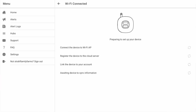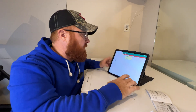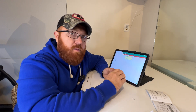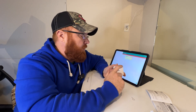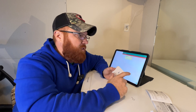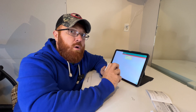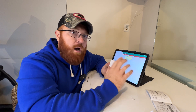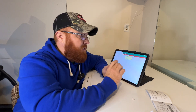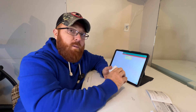We're just waiting for it to say congrats — hopefully it'll pop up here in a minute. One hour later. After about an hour of frustration trying to figure out how to make these things work, I finally got it figured out. It would not let me set this up on wireless, so I tried setting it up on Ethernet, and it didn't want to let me do that either. The only way I was able to get these to work was by connecting it to Wi-Fi while having my Ethernet cord plugged into the back — the minute I took the Ethernet cord out, it would quit working. I'm going to call support to figure that out, but just keep that in mind if you decide to go with these sensors.